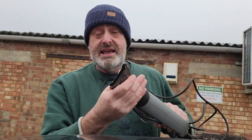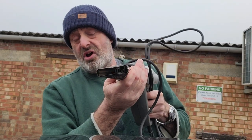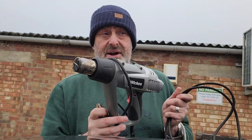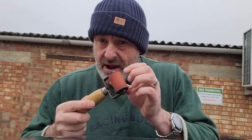You're going to need a heat gun. You can get proper heat guns — this one has the directional attachment on the front. This is just a normal wallpaper stripping gun. They do make specific ones for curtains, but we're hoping this does the trick nicely. You'll also need a rubber roller — it's got to be rubber, because if you use a plastic roller while heating the webbing, it's going to get hot and melt. Oh, and you may also need an extension lead.